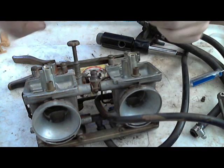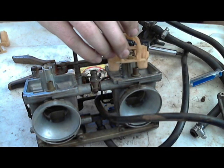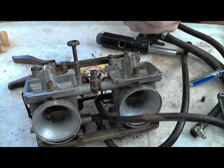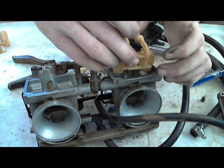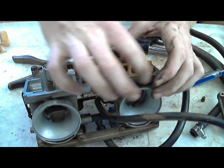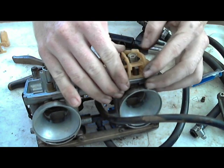So some motorcycles will have three different sets of jets inside. Okay, now I can put this on. And is this the right one? Okay, I want to make sure that this little dangling thing that's in the middle goes inside that hole where the fuel comes into the carburetors. You can tell that's the fuel inlet, fuel comes in through there, and it controls how much fuel comes in based on how high the float is. So